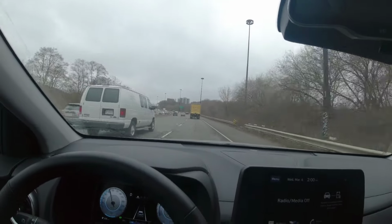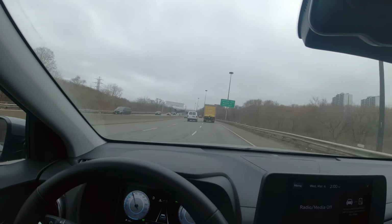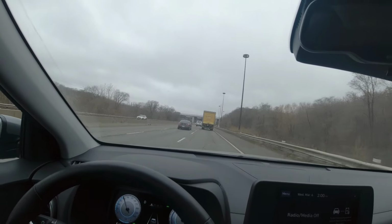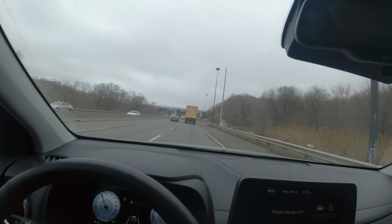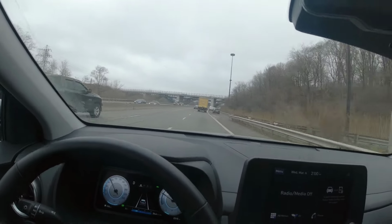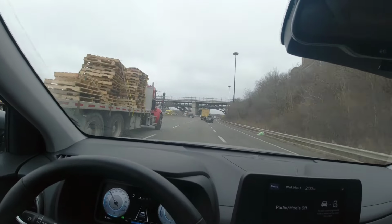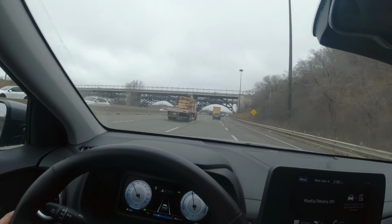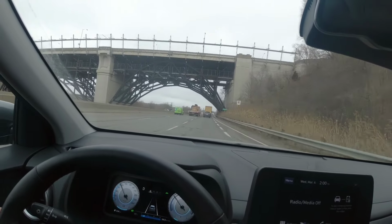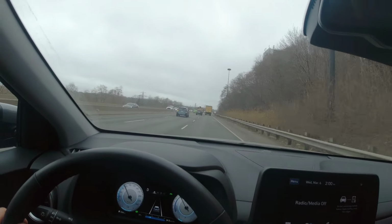Because the first time, I thought there's something wrong, the coolant didn't even go down. So I just let it run with the water pump circulation function, and after four times it's done. I know there's no process for the whole thing on dropping the battery, what I did and this and that, but yeah. So if you guys have that issue, especially on this Kona, these EV vehicles, the relays are inside the battery, so there's no other way to check that.